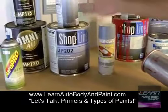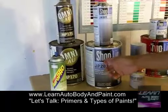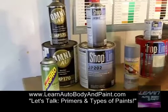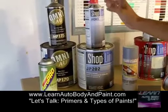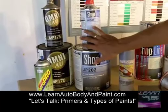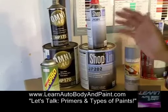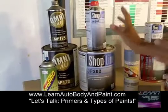This is your 2K primer — it's a high-build. It fills up, so you can have your car sanded, prime it with this stuff, and then you're good to water sand with 400 to 600 wet sand grit. This way you have a nice finish to put your base coat or any type of paint on top of it. They say that you need to put sealer on top of this, but you don't have to. Don't let them sell you on sealers, because you don't need it. We'll talk more about that in depth in the course.